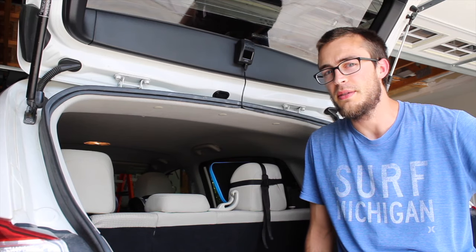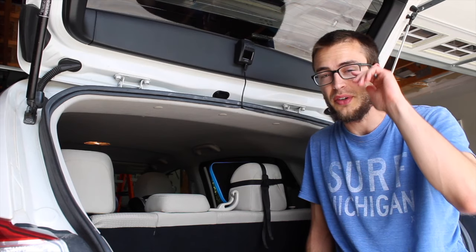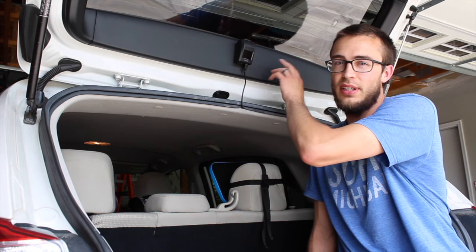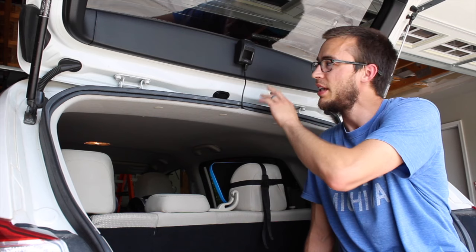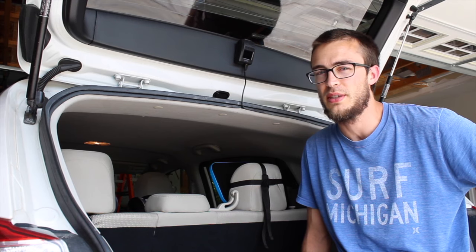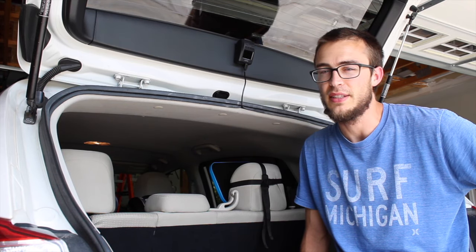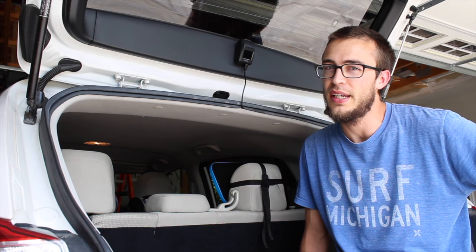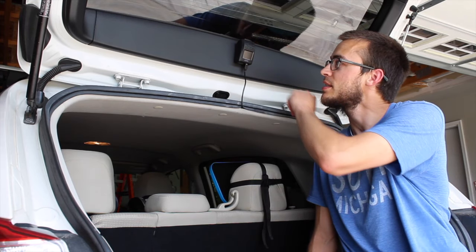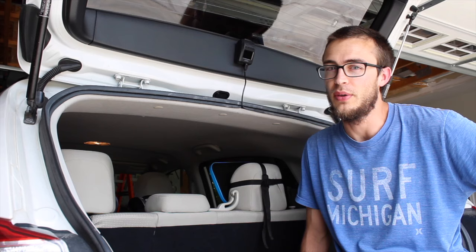The first thing you're going to want to do is figure out where you want to mount your dash cam. I suggest you try and find a spot that is not on the back window, because most back windows have defrosting lines. If you ever take your dash cam off, it'll leave a sticky residue on the defrosting lines, and it'll be trickier to clean because you don't want to use a razor blade or anything corrosive — it can damage the defrosting mechanism. Also, if you have window tint, you don't want to have to redo the tint just because you want to move your dash cam.